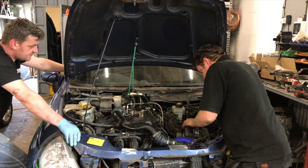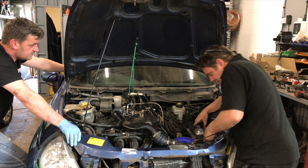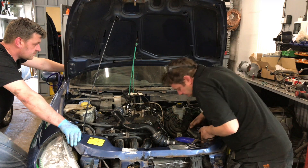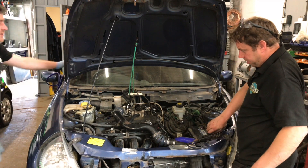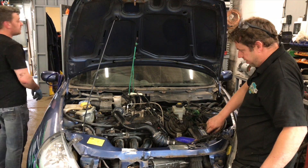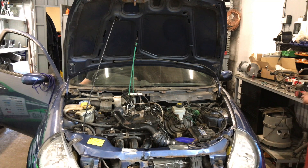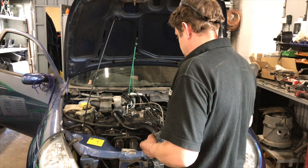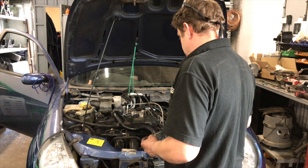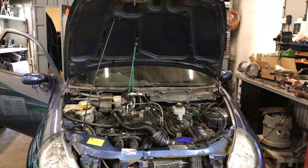It's a tight fit - never thought about the battery and that boost pipe colliding. They're not quite touching though - tight fit, she's in. It's going to be proper loud. Got any ear defenders? We'll run it - 20 seconds on tickover, then we'll start seeing a little boost. That's when you're going to have to start checking the pipes and see whether everything's holding. Let's start it up and we'll see if it leaks or anything.